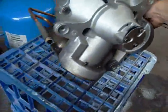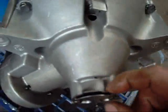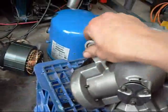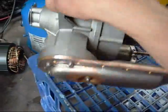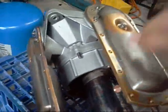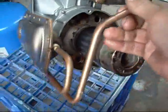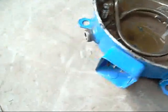It's all free now — it didn't really seize up that bad. You can see the oil pickup inlet; it uses the centrifugal oil transfer system. Obviously one and two cylinders. There are two mufflers — they are hollow with sheet metal baffles — and the discharge tubes which go into one common manifold and out to the outside.